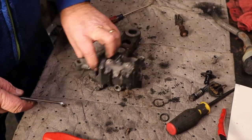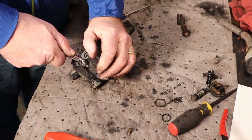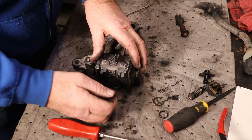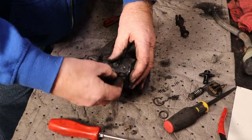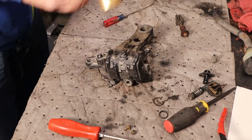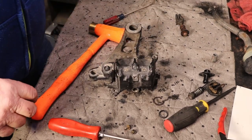That's just a spacer. I'm going to roll this so I've got some room to work on this bolt. Good golly, that baby's tight — tighter than a bull's butt in fly season. This little clip holds two pins in place. These pins can be a son of a gun because they like to seize inside this caliper body. That one's not too bad, neither is that one — I am pleasantly surprised already.